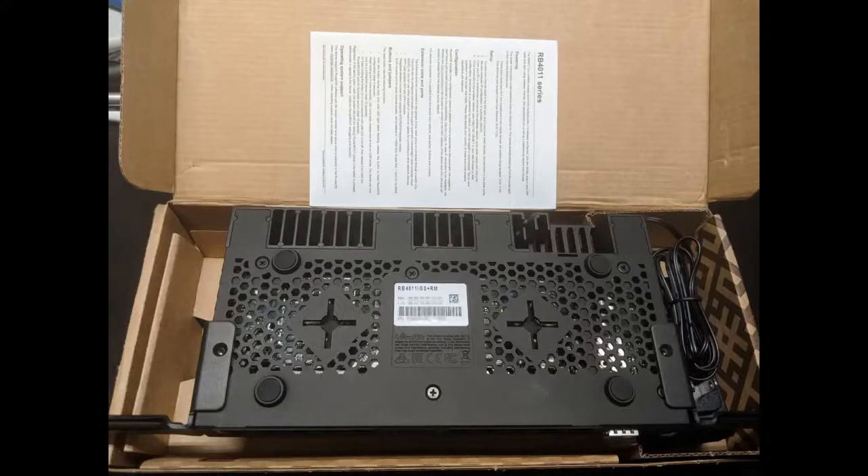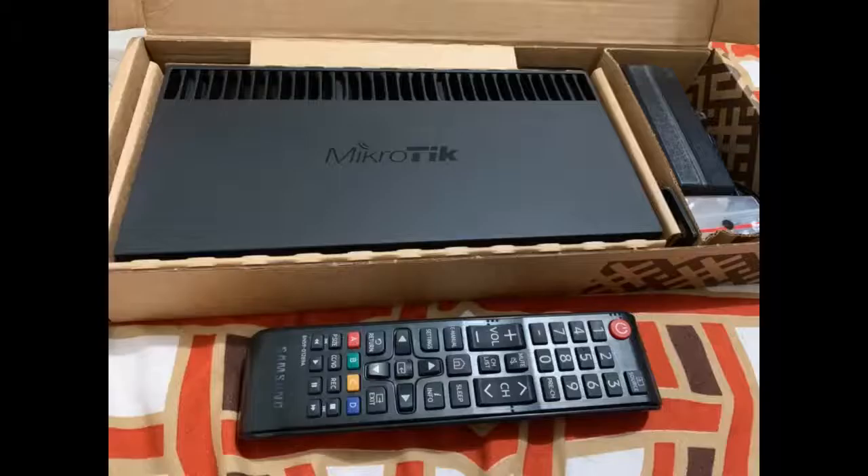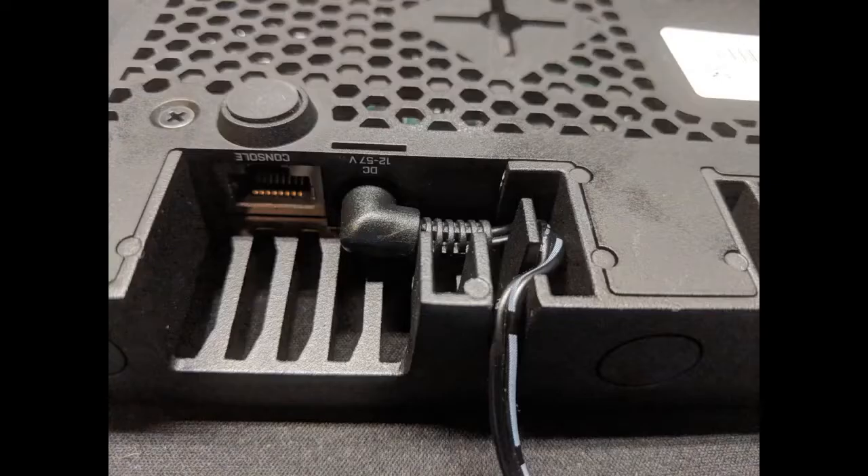The RB4011, being one of the first hardware devices I have had from MikroTik, has been great. Setup with the web GUI was pretty easy to follow. I shipped it to my colo rack miles away and had an issue with not being able to remote access via the WAN port, but connecting a console cable made it easy to fix. It is currently holding a full IPv4 and IPv6 BGP session with no issues. The SFP Plus port worked well with my 10Gbps copper SFP Plus module.